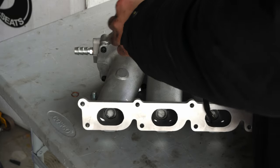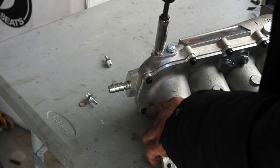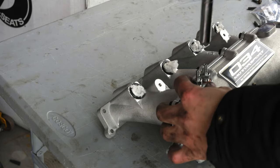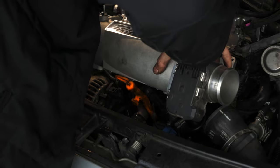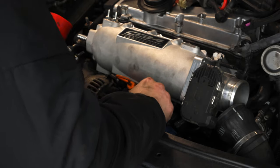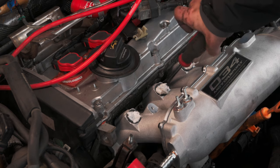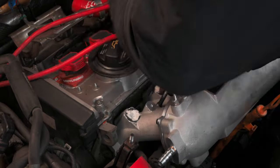The taps I put in for the two vacuum lines underneath the intake manifold are really, really close to the alternator due to the increased plenum size. I'd rather them be a little bit further away, so we're going to switch them to the top side of the intake manifold. This is actually going to be kind of cool because it'll give us the chance to reroute a lot of the vacuum lines for a much cleaner setup in the bay. Issue one checked off. Now we can get back into reinstalling the thing. I'm using new install hardware and following the specific torque pattern for an intake manifold. It's a lot less torque than you would think — you start on the inside and alternate your way out. Most 1.8s are around 7 foot-pounds, but I do suggest you double check this for your specific block and intake manifold. A lot of people also say you should torque it and then come back 30 minutes later and recheck them.